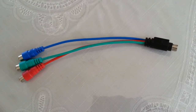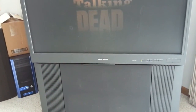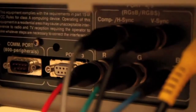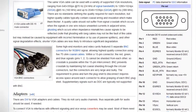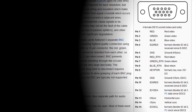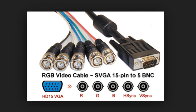From there, I knew the only way to get this thing to work with this television would be to exploit a very special feature unique to Mitsubishi brand CRT rear projection television sets — their inclusion of RGB inputs. If you've ever seen an old CRT monitor or CRT front projector, they often have BNC ports labeled RGB, H, and V. Those are basically the same signals that are in a VGA cable. The only difference between those and a standard VGA port, besides the physical connectors, is that VGA has some extra pins that allow two-way operation — letting the monitor tell the computer what resolutions it supports. So I'm able to use the same VGA to RGBHV breakout cable one might use when hooking up a computer to a standard CRT projector.